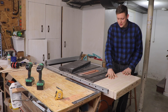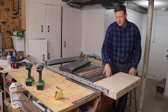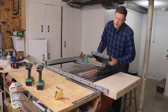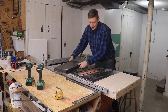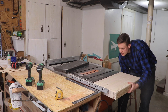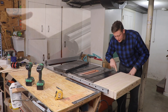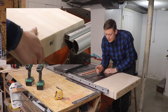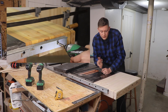Did a test fit and everything looks really great. I've got two pins on this side slid into the T-track already, and this section is leaning up on the bump-out — that's why it's staying still. To find the markings, I took the old steel wing, put this upside down, transferred the holes, drilled some, used some screws I had, and it worked out really nicely. This will be nice and level. I've got two screws in the T-track, a hole here and two holes over here. I'm going to pre-drill some holes and then drive in about three-inch lag screws with a washer to hold this in place.